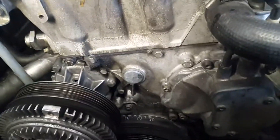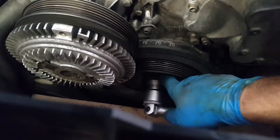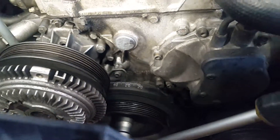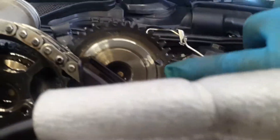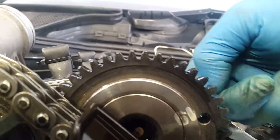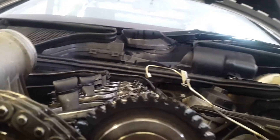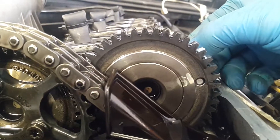As you see, you need a 27 mm socket. You need to rotate the engine — very important, only rotate clockwise — to the point at which you can align this hole with the hole that is on the back. Just to give you an idea, at this point you can easily put a pin in this hole, in this way.